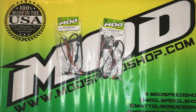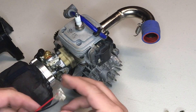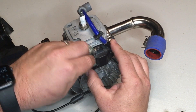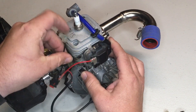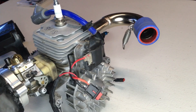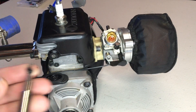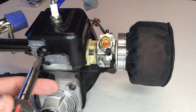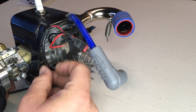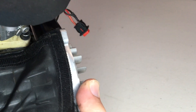Now I'm going to demonstrate how to install these two different style kill switches — let's jump into the build. You will start by removing the OEM kill switch. Now we will install the Mod Killswitch. With the wires installed on the coil, it doesn't matter which side goes on which. We'll replace the cover and install the screw on the front. Now we're going to route this wire down by the carburetor, and it will come out on the bottom side, as you can see here.